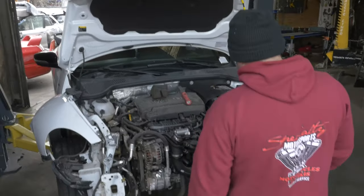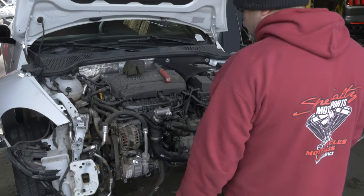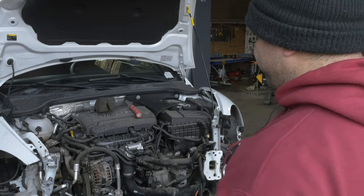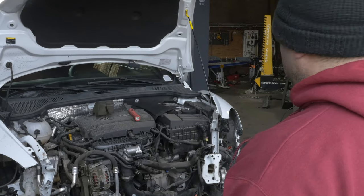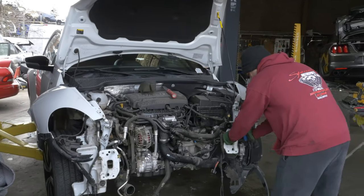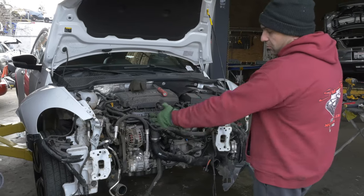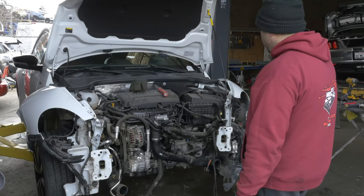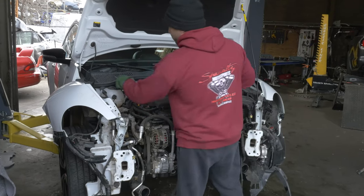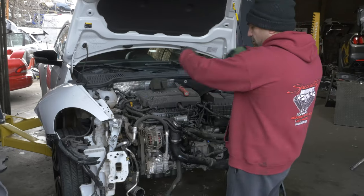Okay. That's pretty much it for the teardown. Not that bad at all, actually. I thought it'd be worse. Take the fenders off? Yeah, I'm gonna take the fenders off. I think what we'll end up doing is we'll hook in this rail and pull this out to where it needs to be. We'll pull that one over as well. And then I'm gonna take all this off, and there's gonna be measuring points on the towers to tram across these bolts.